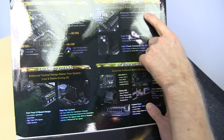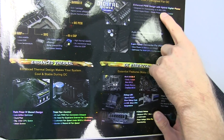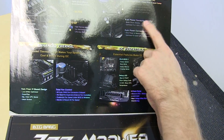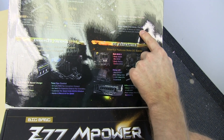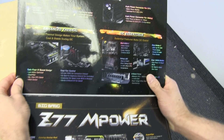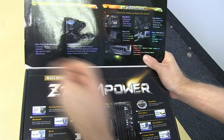Hybrid digital power — interesting. Enhanced PWM design with hybrid digital power, designed for overclocking on K-SKU CPUs — so yes, overclockable CPUs. There's an 8-pin power for the CPU with a 6-pin auxiliary power for video cards. These are useful, and I prefer a 6-pin to a Molex, because these days I hardly have any Molexes in my system and it's hard to route one up there.